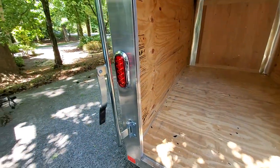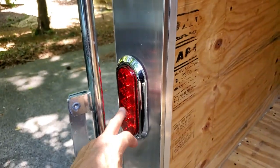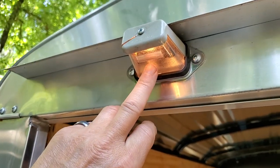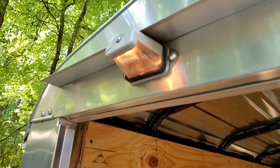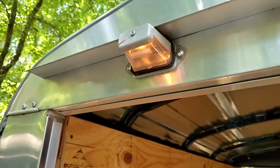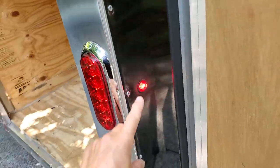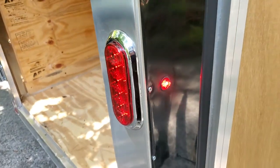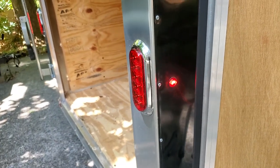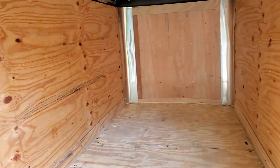You also need to check any lights on the trailer itself — make sure no bulbs are broken. This one has LEDs down here, but up here it has standard incandescent bulbs. And if your bulb is burst, corroded, or just nasty, that can cause a short and blow the fuse in your car. So you need to investigate each light on the trailer, even if you have side lights like this one. If yours has regular bulbs on the sides or over the fenders, you're going to have to remove those bulbs and look in there to see if the sockets themselves have a problem.